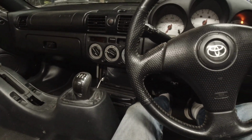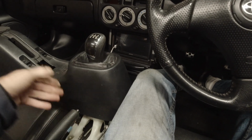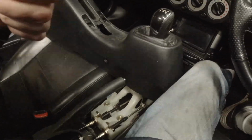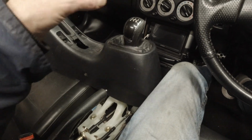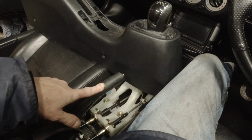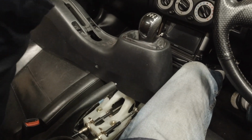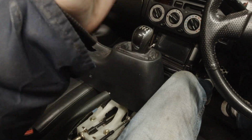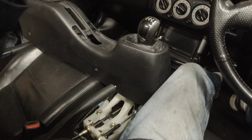And the other thing I've read in the book, and I've never read the book for this car, it does tell you in the book, when you set the parking brake, the e-brake, whatever you want to call it, you shouldn't just pull the lever up. You should have your foot on the brake when you set the parking brake. Reason being is the piston is now hydraulically clamping the disc. Now you mechanically clamp the disc, so when you release your foot brake, you've got a handbrake that's properly clamped, rather than just relying on the cam mechanism and taking first up the space after the piston's gone back. You've clamped that disc with it already clamped, and you can guarantee your handbrake's then going to work.